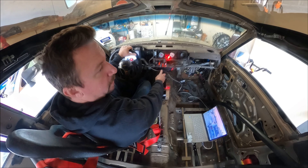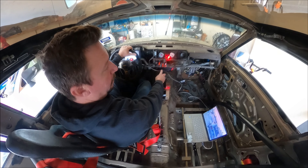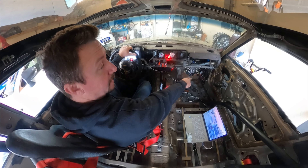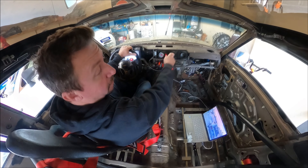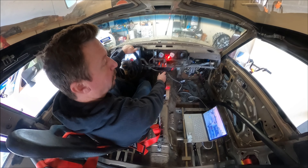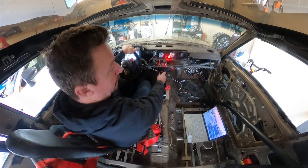The thing that's strange is all of the fuses in that fuse box are less than 30 amps, so somehow the 30-amp fuse blew. That tells me there's not any one component that shorted out or pulled excessive current, because more than likely it would just blow the one fuse in here. Instead the main fuse under the hood blew, which tells me I might just have too much stuff on that circuit. So I added a 40-amp fuse to it to see how that does, and hopefully we don't have any other problems.